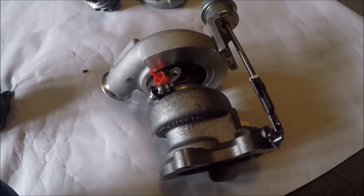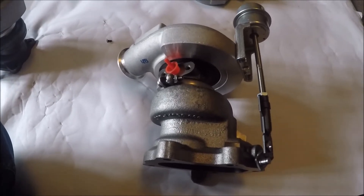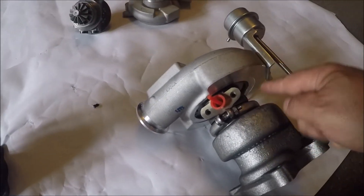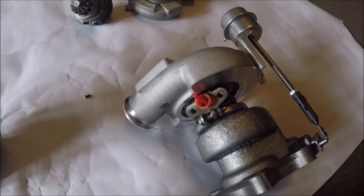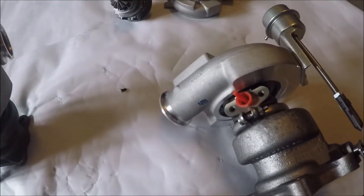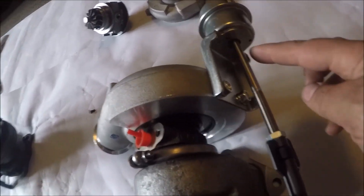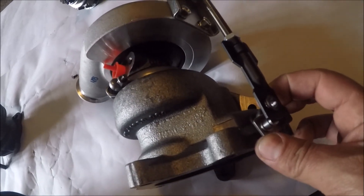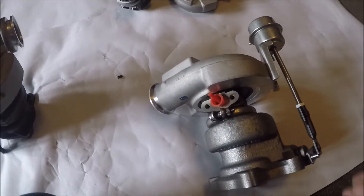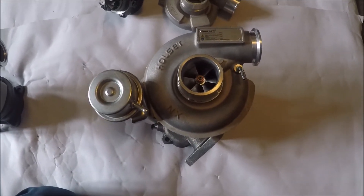With Imprezas having awkward flanges, bolt-on turbos are usually either really high priced or crap, whereas these are awesome spec, very powerful turbos that you can get for about 500 quid brand new. The core here can be rotated 360 degrees so you can line it up perfectly. Even the standard actuator bracket is in the right sort of place on the compressor housing, so the outlet's going the right direction. All you'd need to do is maybe get a longer actuator or re-drill the bracket to move it back about an inch, and job done. You've got a 350 brake capable, high boost capable, very efficient, very reliable, brand new Holset turbo for about 500 quid.